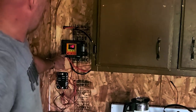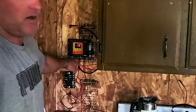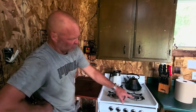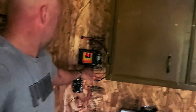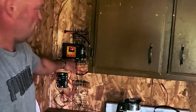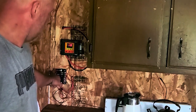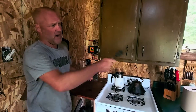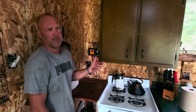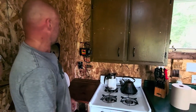You have your solar panel input, and you have your battery connection. I have a 10-gauge wire that goes from the regulator down to the battery — direct to the battery. And then there's also a power output right here that goes into my fuse panel. It looks like a little bit of a mess, but basically it's six circuits. I ran the water pump and my radio on a separate circuit, and the lights on one circuit. If you calculate the amperages allowed for those wires, they're plenty big — it's not an issue at all.